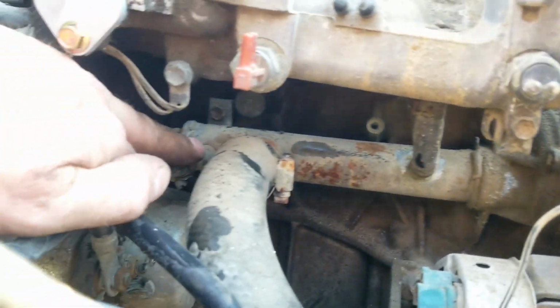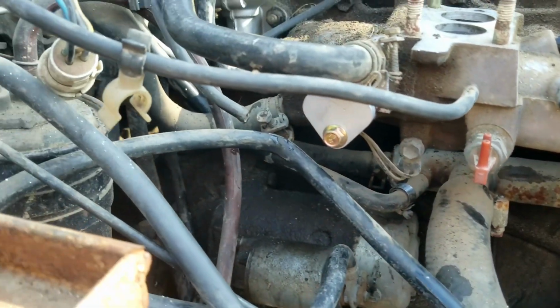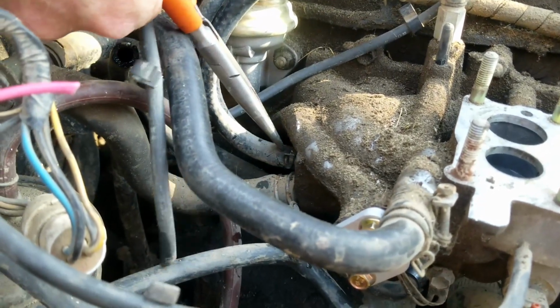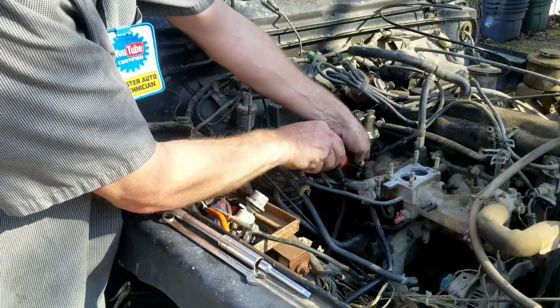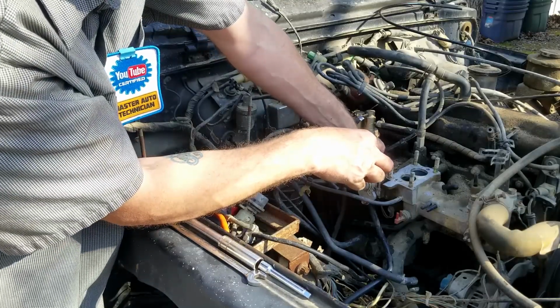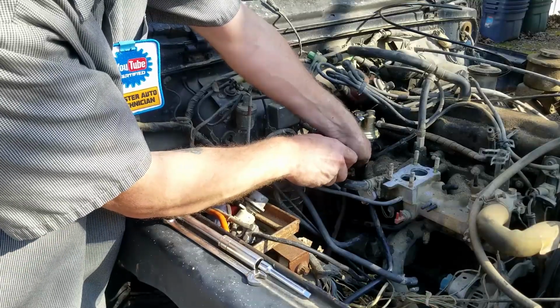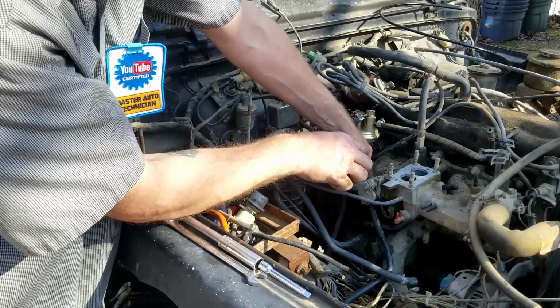Coming back at your water pump, all the way across, right behind the coolant. Got it. Low radiator hose. You follow that, and that hose goes into that line right there. Turn this hose clamp around. Reroute the coolant hose going to the choke on the stock carb to this location, where the second choke coolant hose was located. The water will now just make a loop.